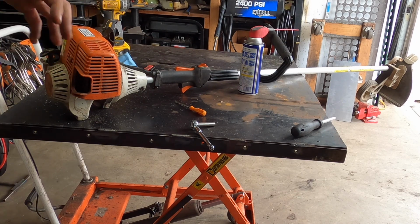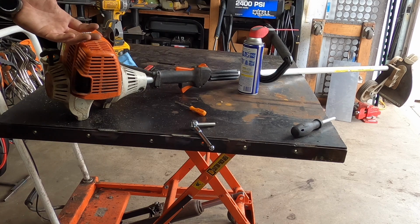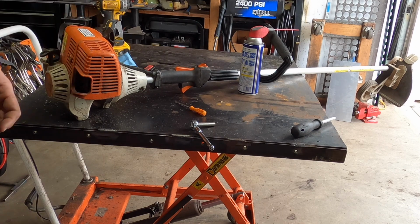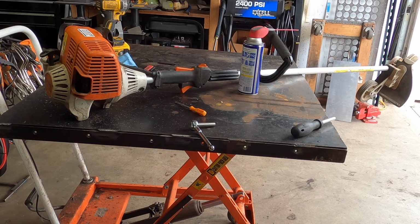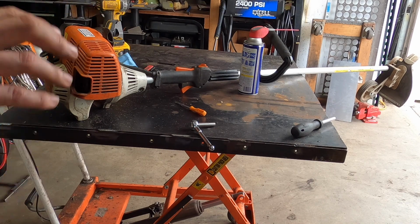There'll be a big difference if there's a very large amount of wear. And if you have a very large amount of wear, or you're getting vastly different numbers with a wet and dry compression test, you could still do this. And maybe it's exactly the same thing. I'm sure if we did the compression test earlier, it'd be a lot lower, and right now it's a lot higher. So ideally, I should have just done a compression test. That's what I'm trying to get at. But this worked. I'm going to stop babbling.